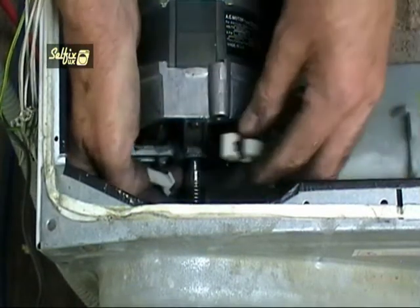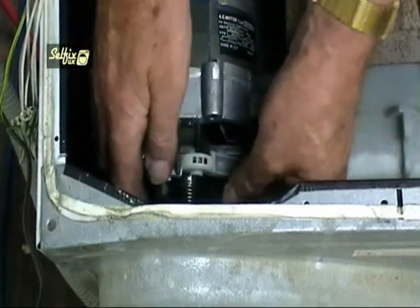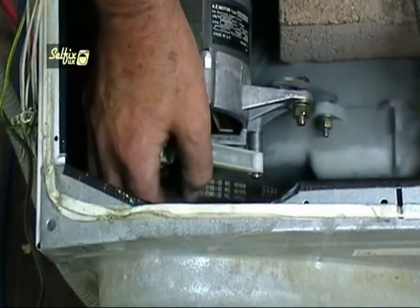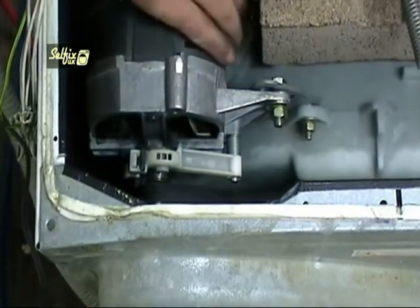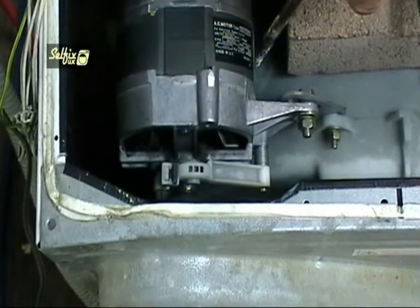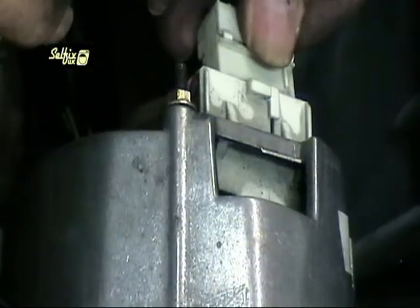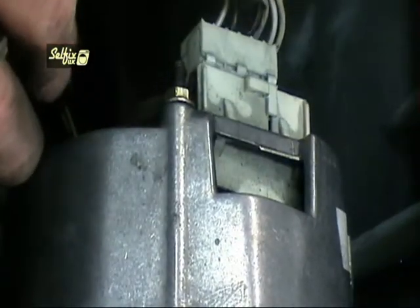The outer sleeve of the pecker cable should have been fitted to the motor while it was out. If not, then do it now and connect the end of the cable into the pecker. Adjust it so there's about a thickness of a 5p piece between it and the motor shaft. With the belt still on the main pulley, loop it over the motor pulley and pull the motor back to tighten it. You may need a lever of some kind to hold it taut while you do up the nut and bolt. Replace the motor plug and don't forget to refit the earth wire.